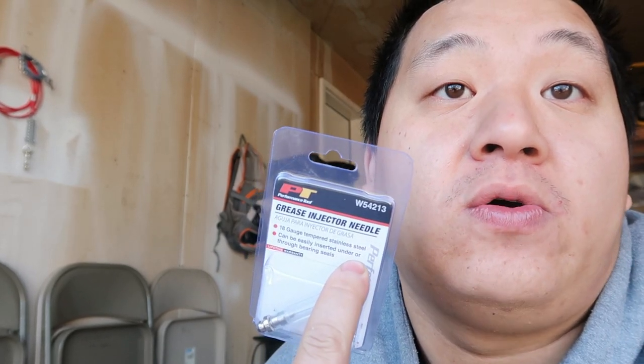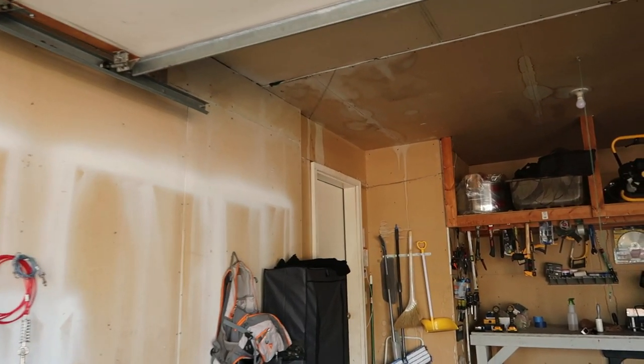What's going on guys? We got a surprise for you today. We're going to fix the truck today. I just got in some JBA upper control arms — I'm super excited. I went ahead and bought a grease gun and the needles as well, because I'll be putting grease into my lower ball joints. They've been making a lot of noise lately, so I'm hoping that it's a good temporary fix until I can get new lower ball joints.